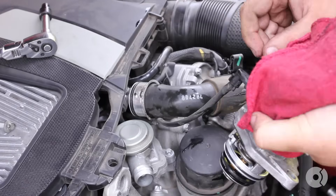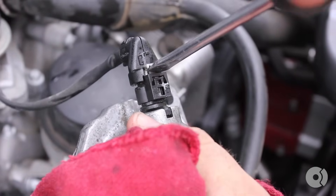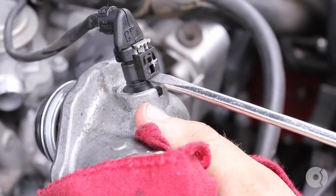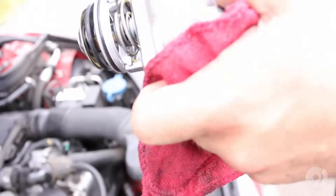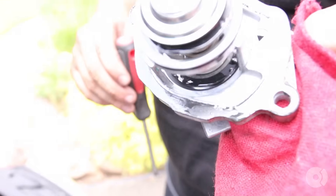And that is the old thermostat — it just came out. Taking a flathead screwdriver, you're going to put it underneath this plastic tab and simply push up — you'll hear a little click. Take the flathead screwdriver, put it under the connector down here and simply pry off. When pulling it off there was some tension — it would wiggle but not quite come off, and that's because of this rubber seal right here, which sits right here on the block.